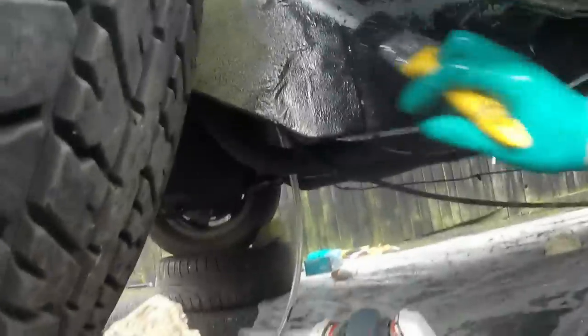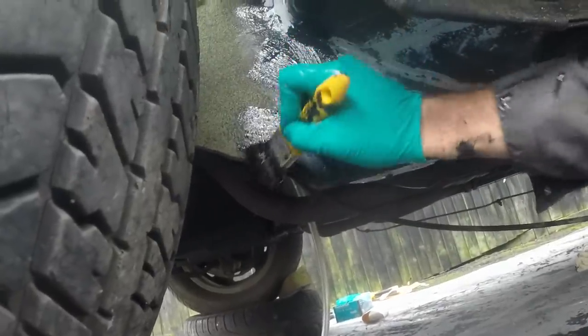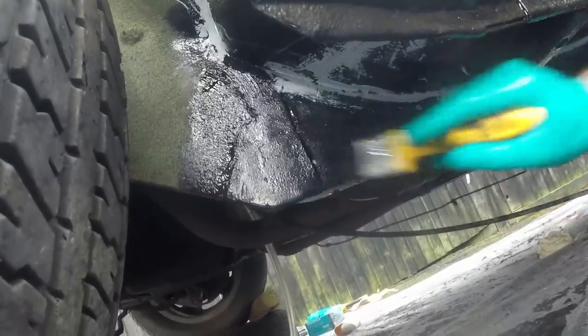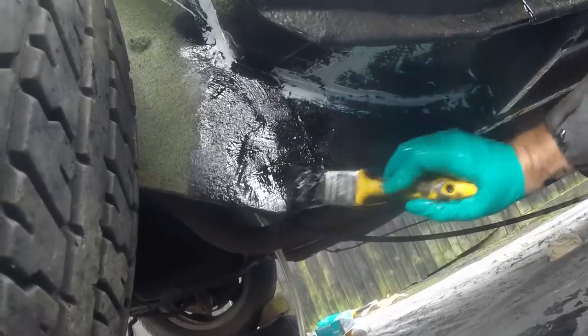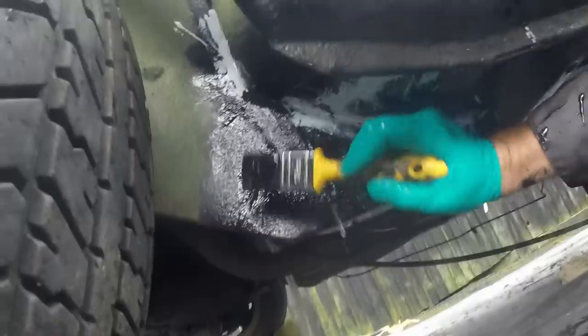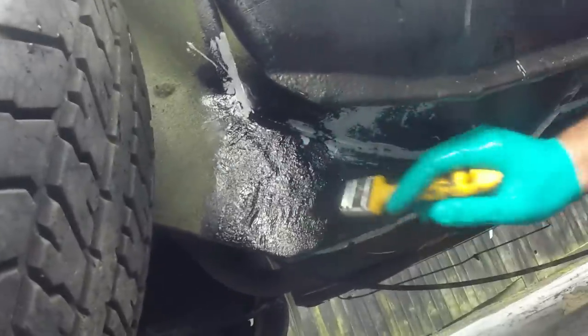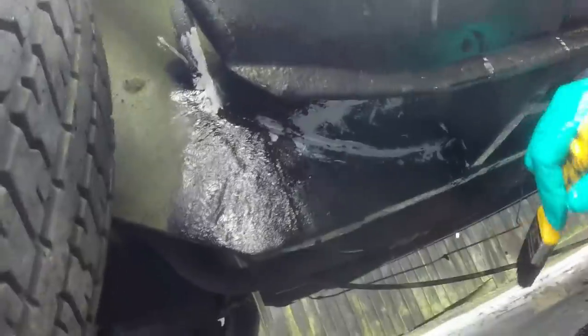It's quite thin — thinner than I thought it was going to be — but it works quite nicely. If you see that bit there it's quite smooth; if I paint it on and then just slap the brush on it face-on you end up with a stipple texture. It doesn't look like it's been sprayed but it's better than having it brush-smooth. I've found that stippling the other way ruins brushes really fast — hence doing it face-on. I'll come back and do the wheel arches fully with the wheels off.